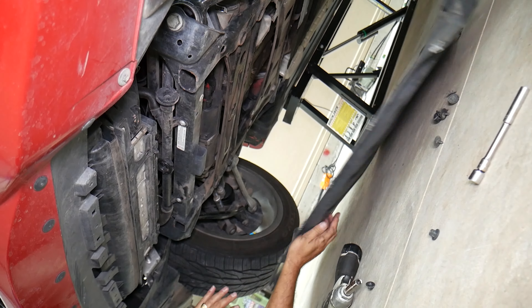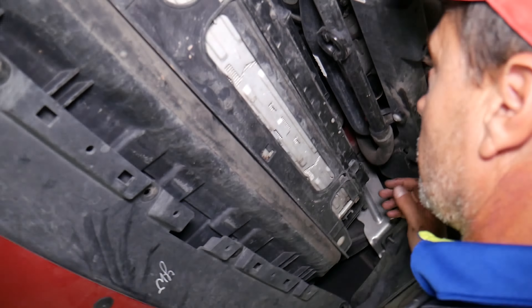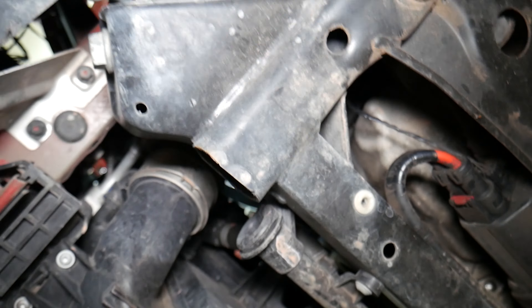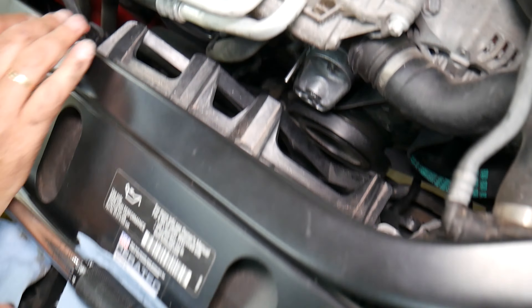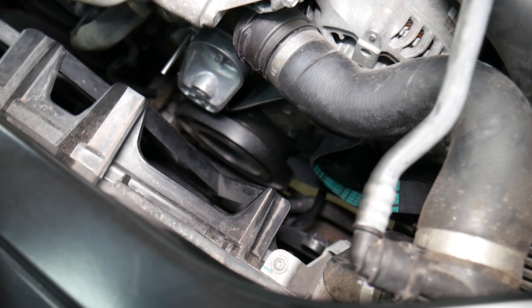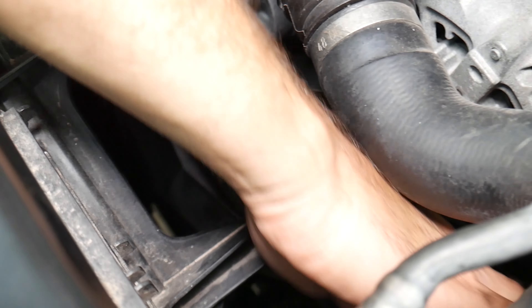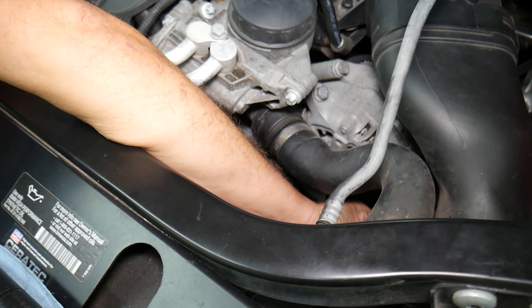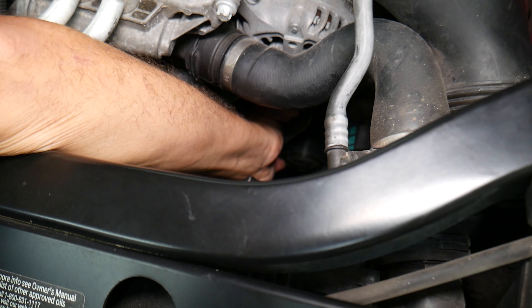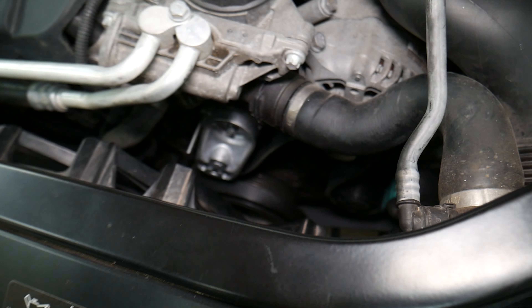On this specific car we remove that undercover. From underneath, the crankshaft pulley is clearly visible and we can pass the belt through. There is a sensor right there as well. We went underneath — there was some plastic around it, so we needed to push the belt to get it onto the crankshaft pulley. Make sure you don't pry on the belt or anything like that because it will break and come off.